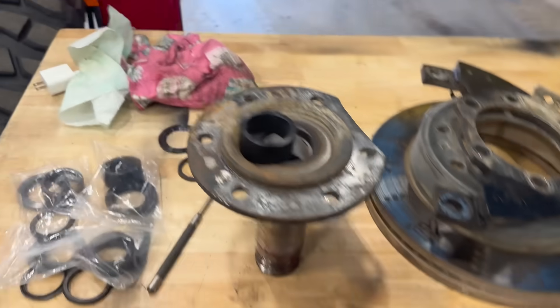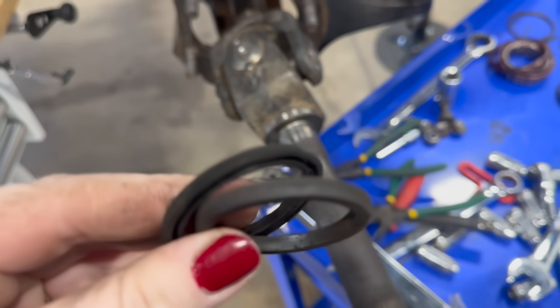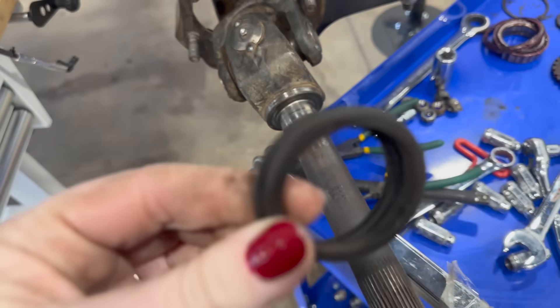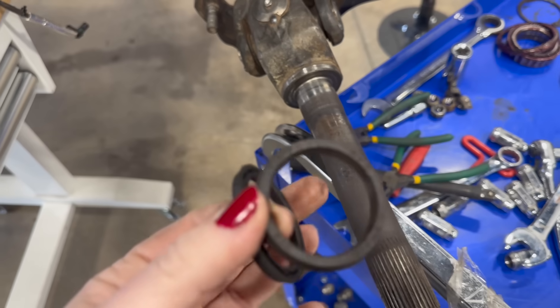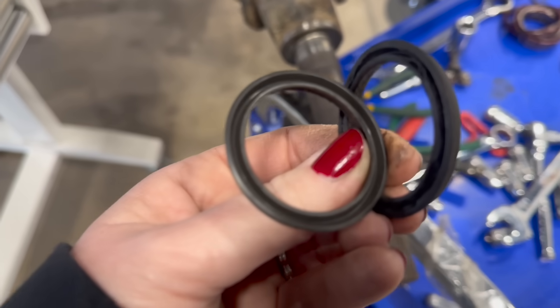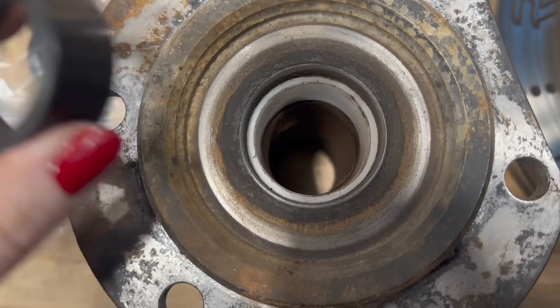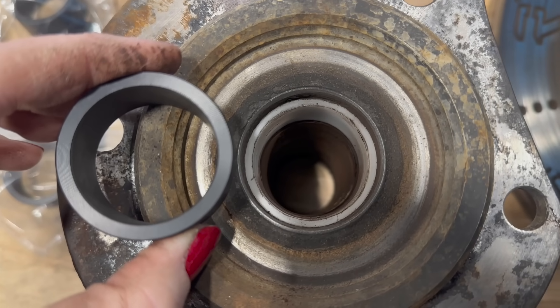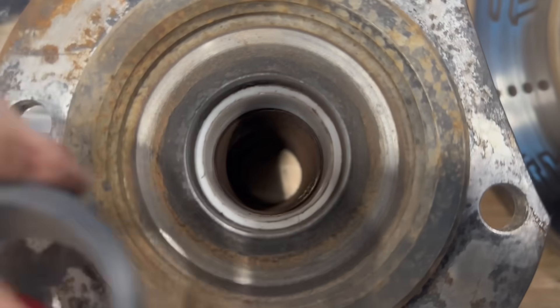Now that I have everything broken down on that passenger side, let's take a look at what I find. Heading over to the spindle — first of all, I find not one but two seals on here. Obviously there's only supposed to be one; I don't know what I was doing that day. That's not going to really have any effect on the heavy vibration, but they look pretty good, so we'll just put one in instead of two. But let's take a look at the poly bushing here — bam! Can you see a difference? That's right — it's the thickness of them both. So let's take this out and take a look at how much we've lost. Yeah, that's significant.